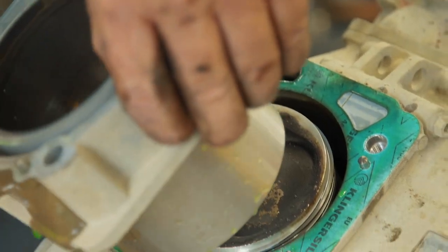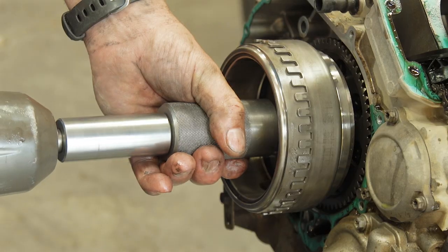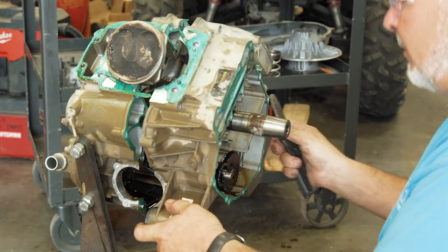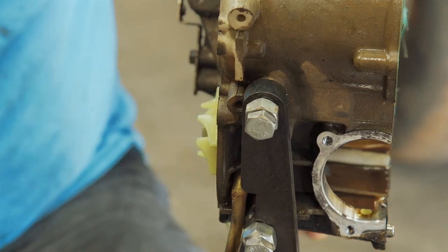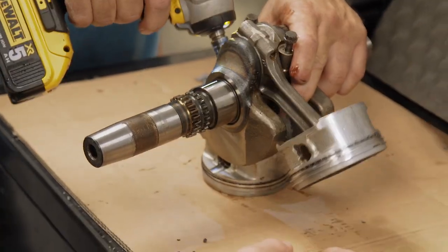At the time there were no good full billet clutches like STM or QSC, so we just had to play with stock clutches. Years ago the first thing we done was modify old Kawasaki Comet clutches - re-machine them so that they would fit the Can-Am taper. It worked good, but it's nothing to what we got now. You can just buy parts off the shelf, bolt them on, and make power.